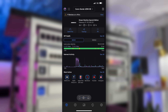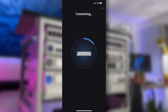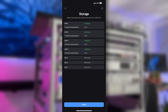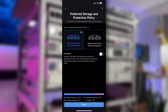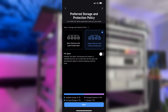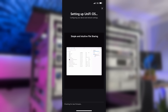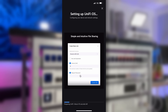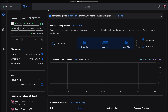The initial setup is pretty straightforward, whether you choose to configure it on the web or with your phone — this is why Bluetooth is included. You'll start by naming your NAS, then you can view all of your drives. Mine are 8TB each. Then you'll select your RAID level. Since I have 4 drives, I can opt for basic protection, higher redundancy, or even dedicate a hot spare. I tend to go with RAID 10 for performance and extra protection. Synchronization can take some time depending on the size and number of drives, but you can still use the drives while this is happening. Once that's done, you'll land on the drive dashboard, which has a familiar UniFi ecosystem look and feel.